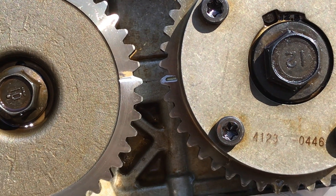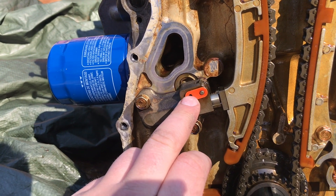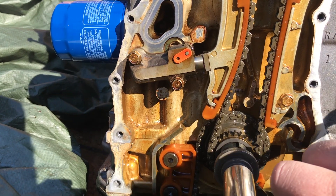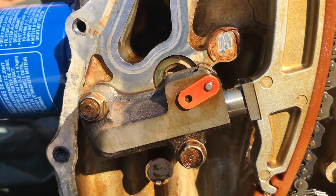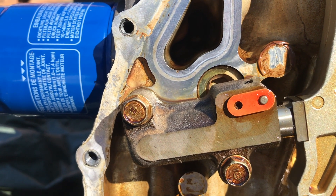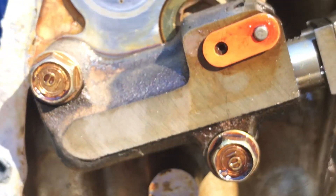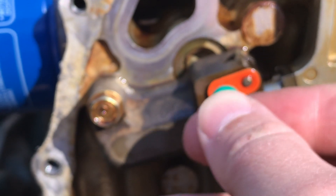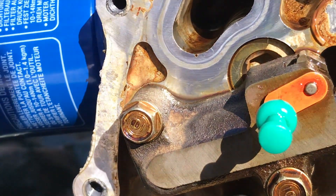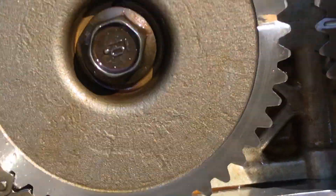What we're going to do now is compress and lock in this spring on the tensioner. We're going to rotate the crank counterclockwise. When the crank is being rotated counterclockwise, you can see the orange tab moving up. You pretty much want to go until you can see the hole inside of that orange link. Once you see that hole, we can put our little pin in there. Then go clockwise to tighten things up a little bit — the marks are still TDC.